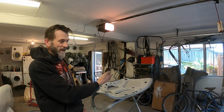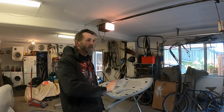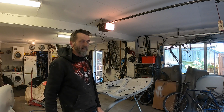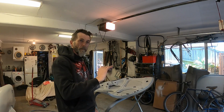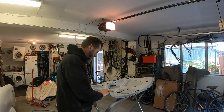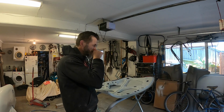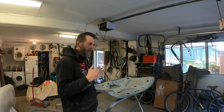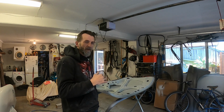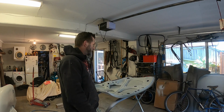Oh yeah, over here now, get it into some different light, found more pinholes that I hadn't sanded flatter, so I've done those and dusted it off again. Now I'm just going to run some spot primer on the bits of exposed steel, just to seal that up. Just putting some 1K primer surfacer on there. It shrinks back a bit, I don't think it's a bad primer on the whole, but it does shrink back if you put lots of it on. So I'm just putting a light dusting on to seal up that steel.